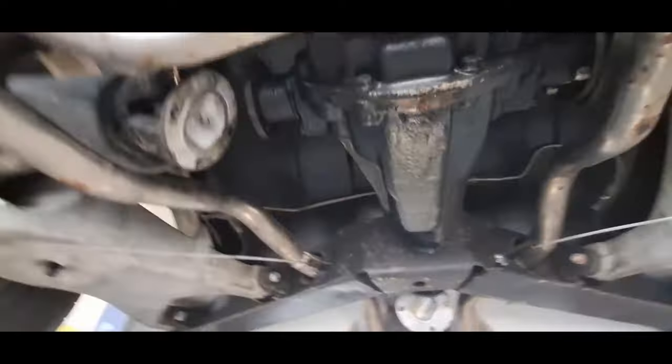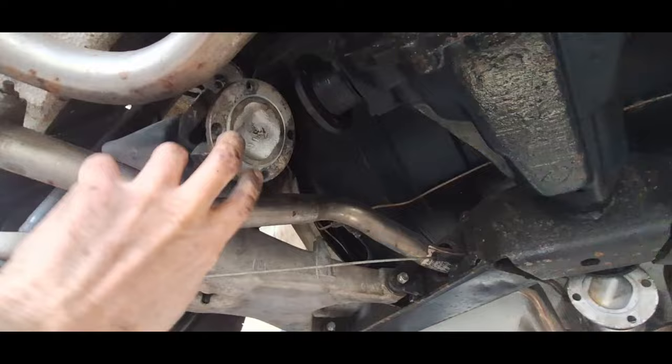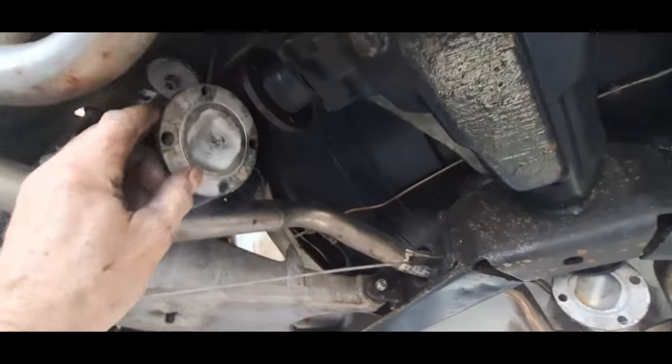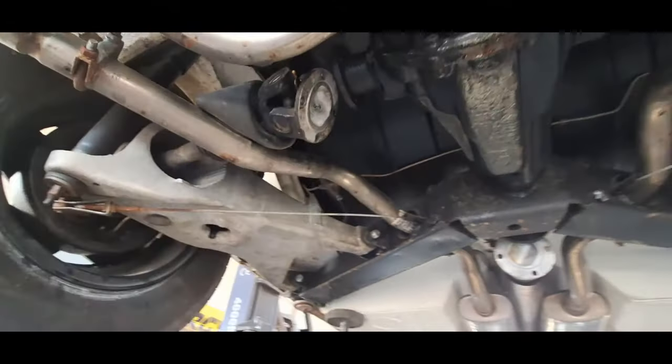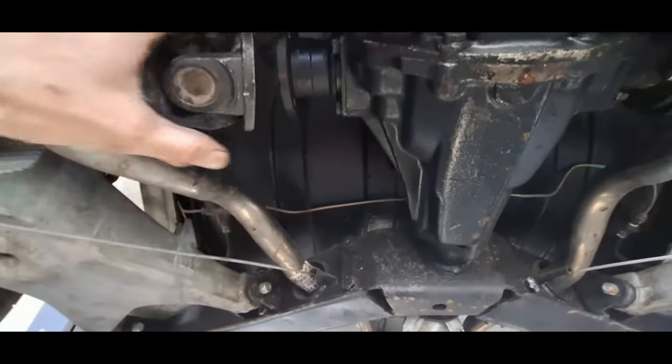As you can see there, I just dropped that drive shaft off. Two 9/16 spanners - these are 3/8 UNF and they should have nylon nuts on the inside. The difficult one to get out is the one where the grease nipple is up at the top there.